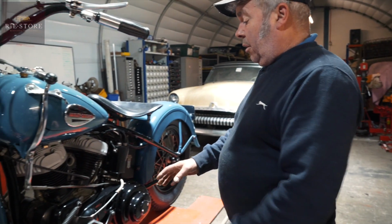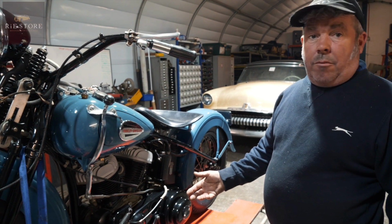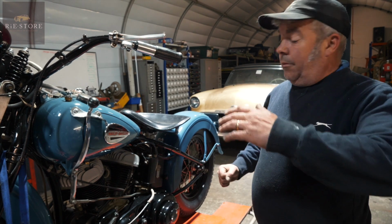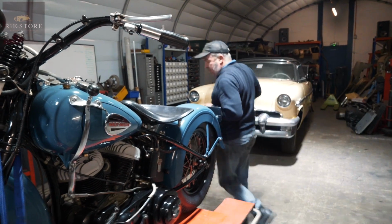So again, make sure you drain the crank, because you can start them with the oil in them, but it'll smoke like hell, and you've got a chance of blowing the bottom of the engine out, because if there's so much oil in it, it's what you call hydraulicing. As a piston goes up, you've got compression. As it comes down, you've got a breather system, which is timed.